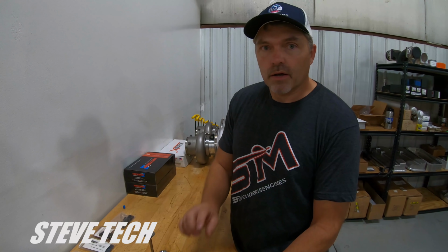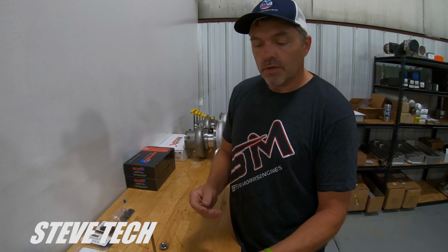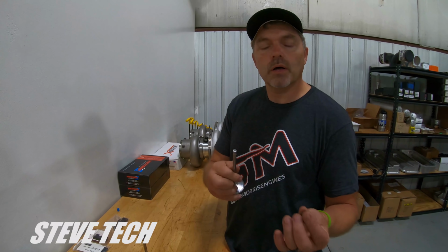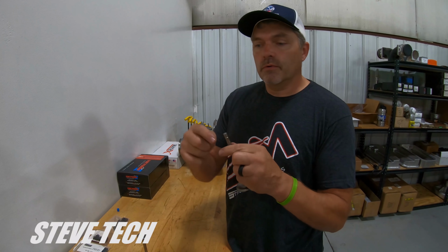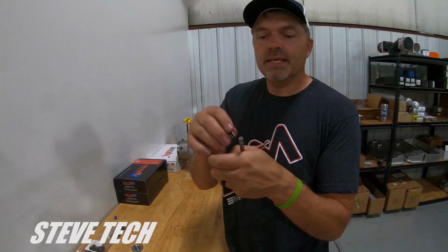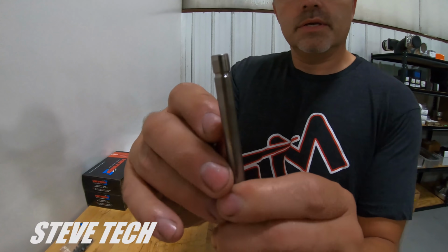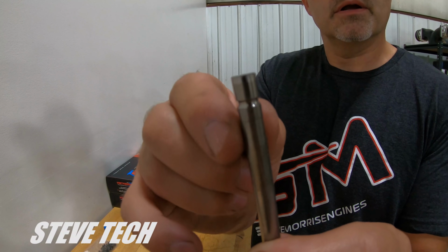All right. Now, so that's on the lash cap side and the hardened tip side. Now, going back to grooves, your typical Chevrolet stuff, Ford stuff, Chrysler stuff, all old school engine build stuff would all have a square groove retainer keeper. The square groove is quite literally that. It's just cut square and square in the keeper. But all LS's and all really good race stuff is going to be a radial groove. If you look here, you can see that is radial. It's actually rounded in there, versus a smaller, thinner square.